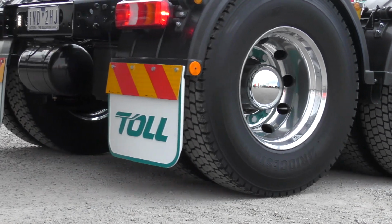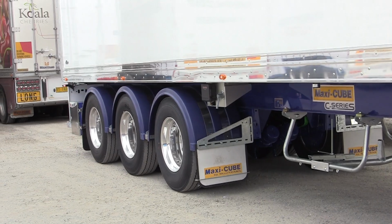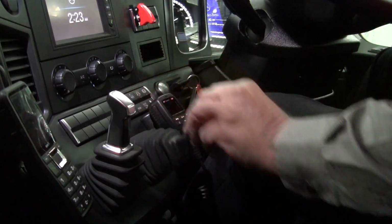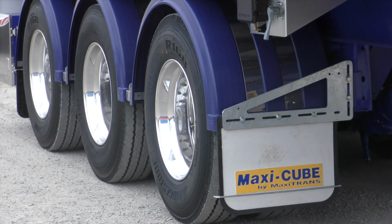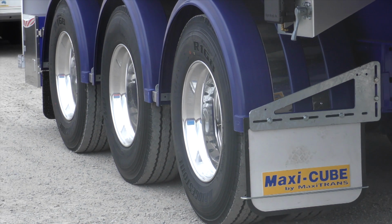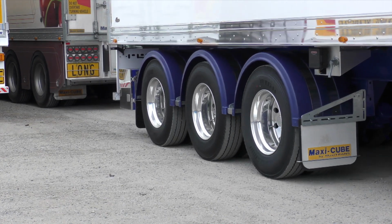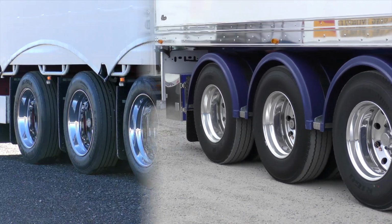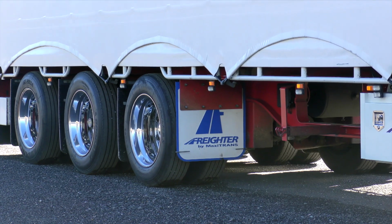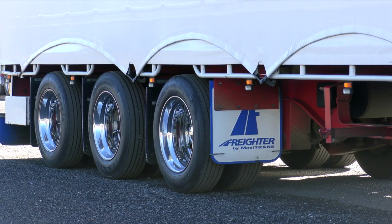As you move forward at low speed, no more than 5 km/h in a straight line, do a third tug test by slowly applying pressure to the trailer brake handpiece. This confirms that the trailer is securely hitched and the supply and service pressure to the trailer brakes have reached operating levels. On trailers with airbag suspension, the trailer should dip slightly to confirm that the brakes are adjusted correctly.